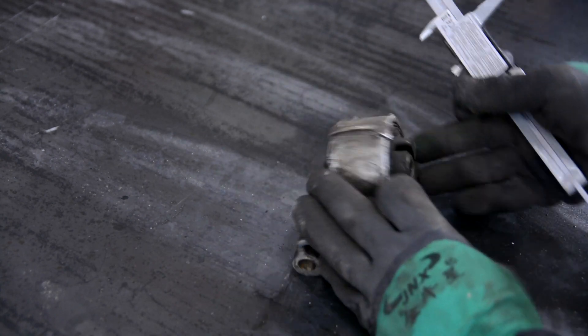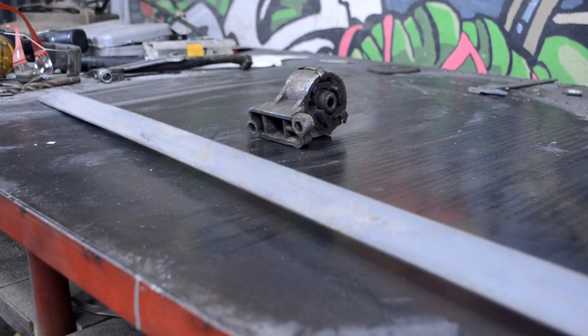We need to make brackets for the front supports that will be welded to the frame. I'll make them from a steel strip, the same as all levers and brackets in the buggy. I made some notchings for convenient bending of the strip into a U-shape.